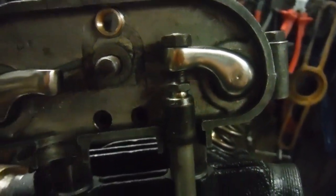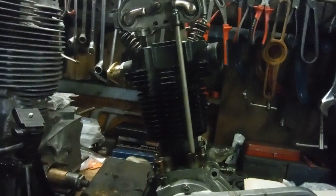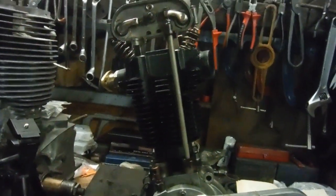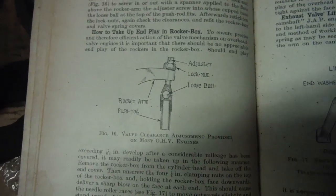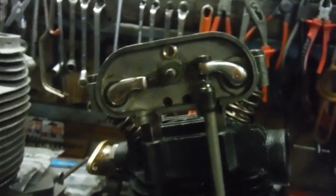As you can see, I've got one set up already, and that gives a nice fit and nice articulation between the end of the pushrod and the rocker. I'm very happy with that. I've got the exhaust one in situ to try out, and I'm sure it's all going to work okay. I'll do likewise with the inlet one. I'm confident enough that I'll actually just fit the pushrod tubes as well at this stage. So that was a lucky bit of remembering on my part — there it is in the book — and that's what I've managed to replicate. Another step forward.